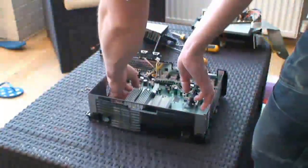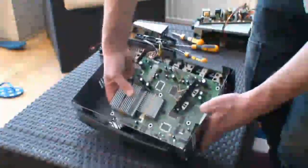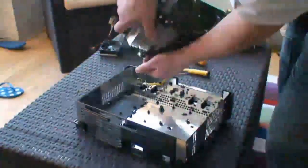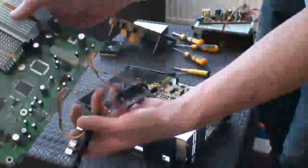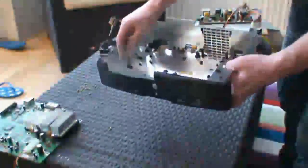You can now lift up the motherboard. Make sure there are no spare screws in there that you haven't taken out. Pull it out, lift it, pull it forward, lift it up — comes out nice and easy. Just make sure there are no screws left on that motherboard so you don't have a short circuit or anything.